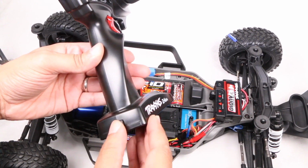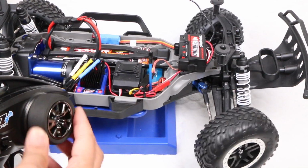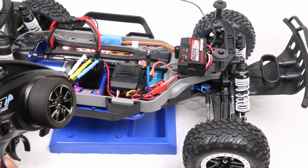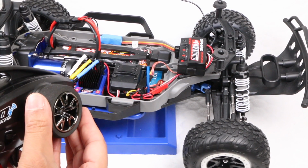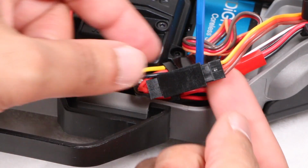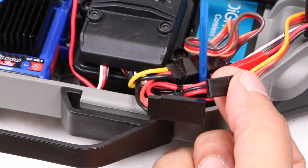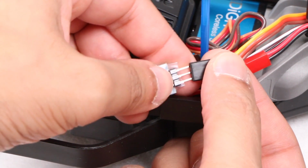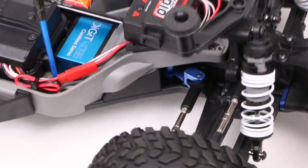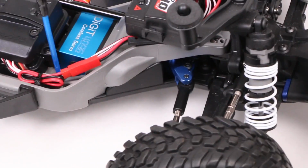When complete, simply power up your transmitter and the vehicle itself, and test your steering to ensure all is working as it should. And we're all done. The Castle Creations BEC is now installed and the servo will operate at its peak performance. If programming of the BEC is necessary at any time, we can simply unplug thanks to that easy bypass adapter, a neat overall solution and concluding the entire steering system upgrade.